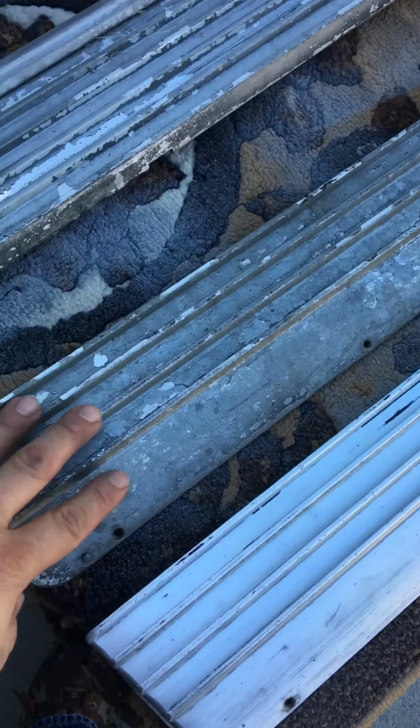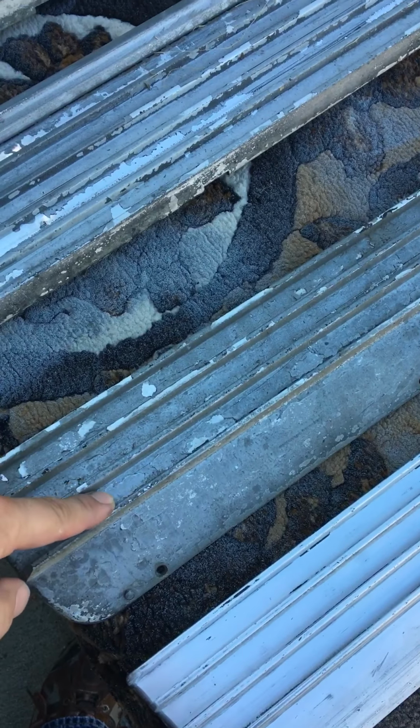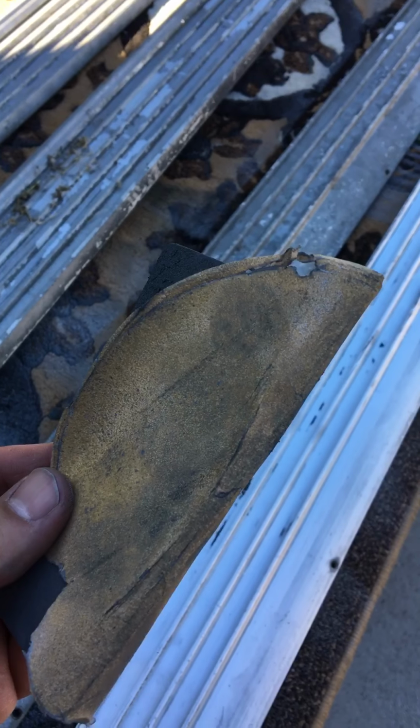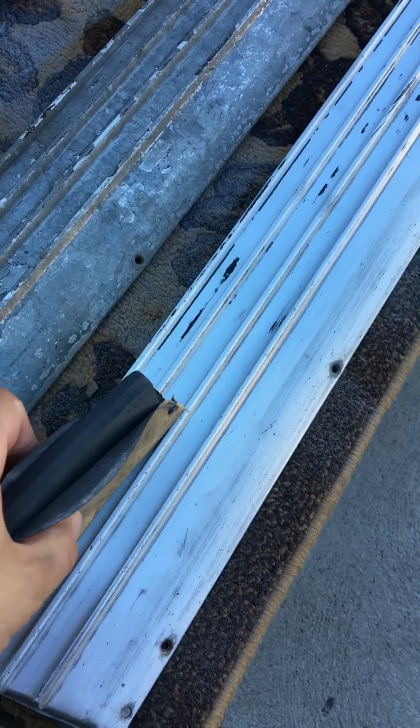So prepping them, whenever you find them, they're usually pretty beat up and painted several times. These were painted with some kind of black primer and then with some silver over. In order to prep it, I had to sand it, so I used 180 on a hand soft block. I just used old 180 discs that I hadn't really completed, and I just went down the tracks with some pretty good strength.